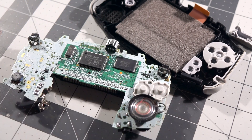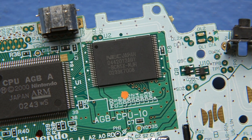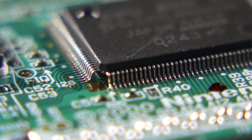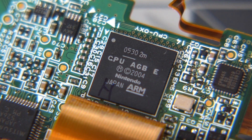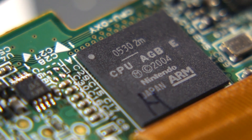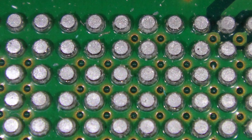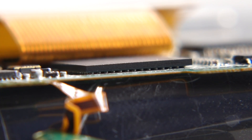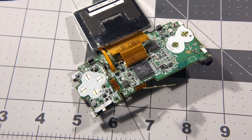But there are two key differences. In the GBA and SP models, 256 kilobytes of work RAM is external to the processor in the form of a separate chip. Also, the processor in those consoles uses what's known as a quad-flat-pack design, where legs stick out all four sides of the chip to solder to pads on the board. Both of these would have taken up too much space on the Micro's logic board, so the RAM got built directly into the processor, saving a separate chip. And to further shrink the amount of space needed, the processor itself was redesigned into a different package known as Ball Grid Array, or BGA. Instead of legs sticking out the sides, the connections are all underneath, arranged in a grid. The chip gets soldered to the board using hot air, and when the solder cools, it solidifies into small balls — hence the name. This is a package type that's still common in today's electronics, and while it makes component-level repairs difficult, it does save significant space.